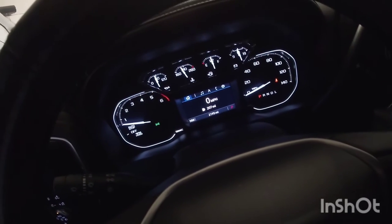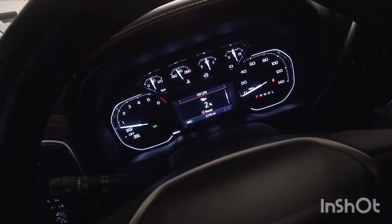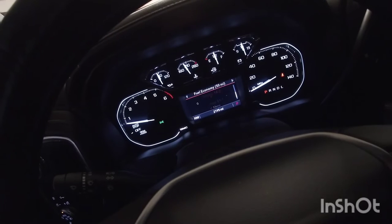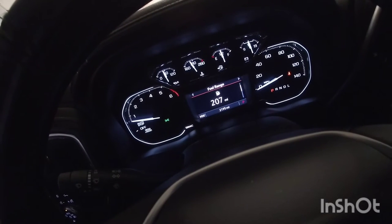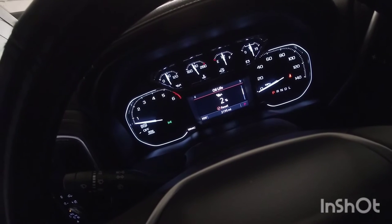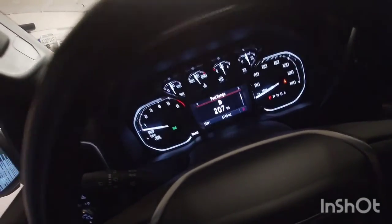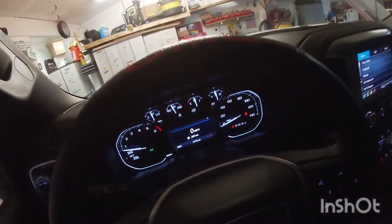We're inside the vehicle. Starting it up — make sure your oil pressure comes up. It does have the 'Change Oil Soon' display. Go to your menu, from home you scroll right through the different options — it shows air filter life and all that. Go to the oil change option and hit the center button to reset it. There we go — 100%.